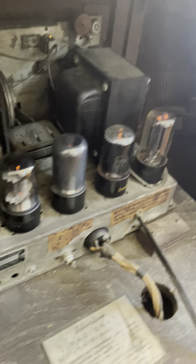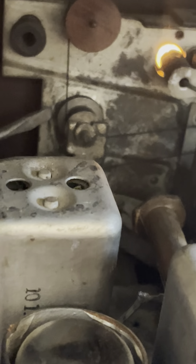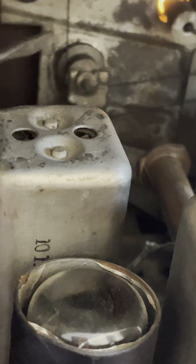The main thing I had to fix — you can see all the tubes back here. I don't know much about radios but it's just common sense. The reason the channel changer was not turning — I had to do it manually — there's a metal thread right here. There's a piece, like some sort of gasket, that attaches to this metal piece and turns the whole thing. The two pieces were disconnected, so after giving it a lot of thought I just went ahead and crazy glued those two pieces back together all the way around the entire seam, then reinstalled it.